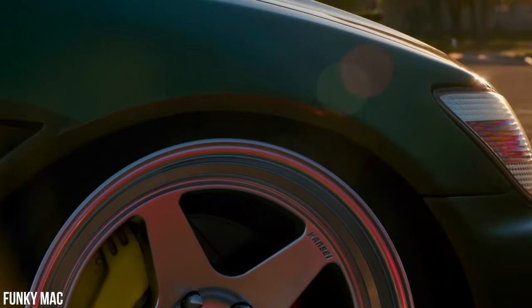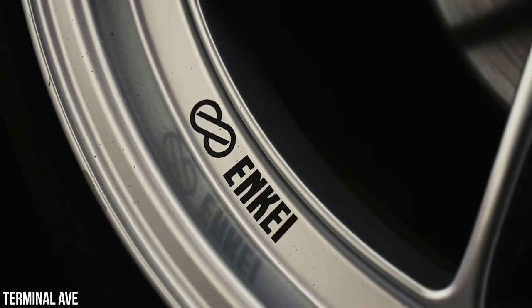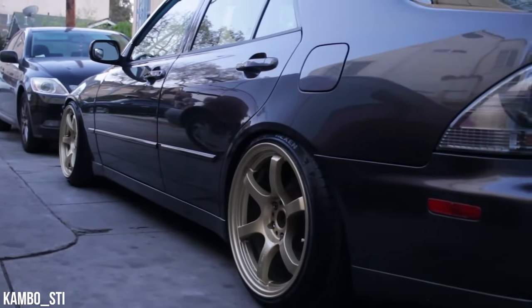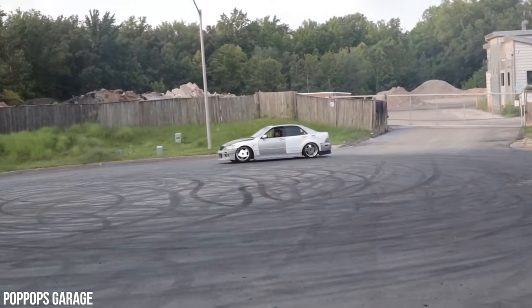18 by 8.5 plus 35 wheels will fit on nearly every sport wagon, sedan, or sport cross with 215/40 or 225/35 tires. For styling, I'd go with something like a five-spoke or simple six-spoke. Enkei has the entire lineup covered and so does Konig — I don't think there's a single Enkei or Konig you could put on this car and it not look good. I like the hypergrams, I like the ultragrams. You can go gram lights 57DRs or CRs, but those get really pricey. The point of the IS300 is to be an affordable entry, so keep it budget-friendly. Big dinner plate wheels like SSRs and OEM wheels just aren't it on this car — the fender above the wheel well is too skinny to accommodate something that chunky.